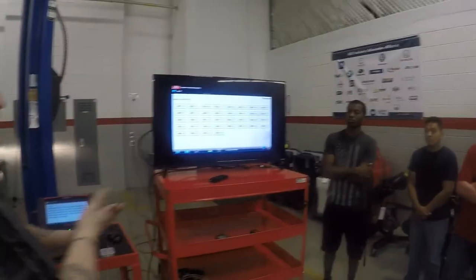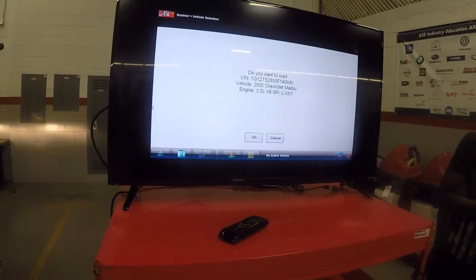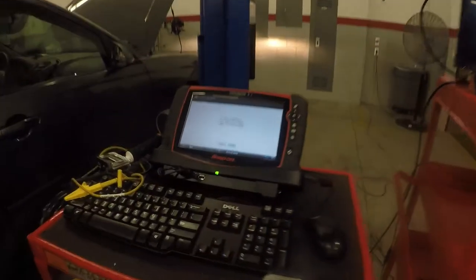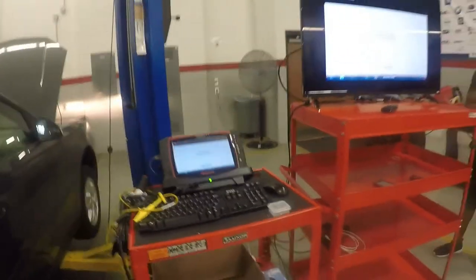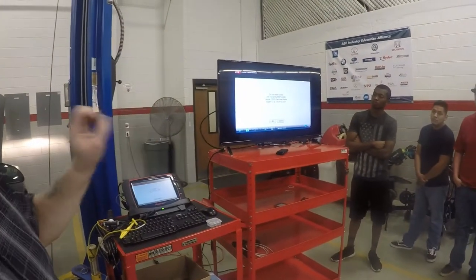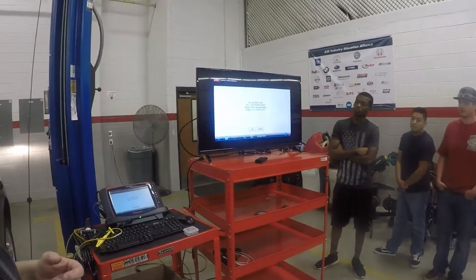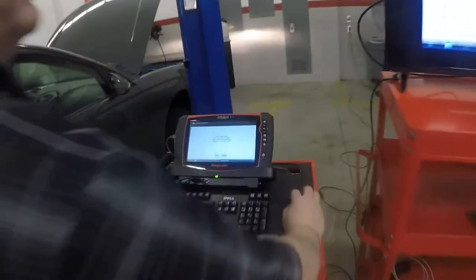You may need your flashlight, but you should be able to look on the windshield. Notice what this did — it did two things. It loaded up that this vehicle was an automatic transmission vehicle, and it automatically loaded the complete VIN for me. It pinged the ECM, read the VIN, read the engine that's in there. Now it's asking me if that's correct. It is correct, so I click OK to load this vehicle up.